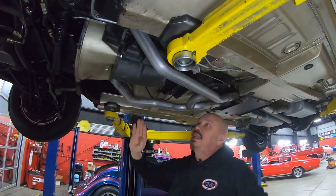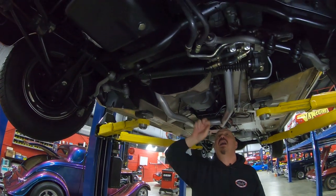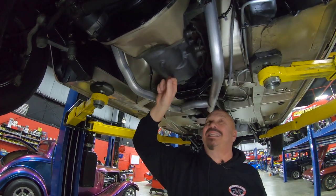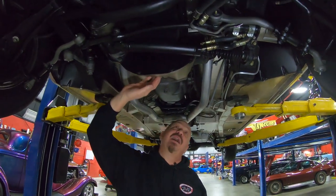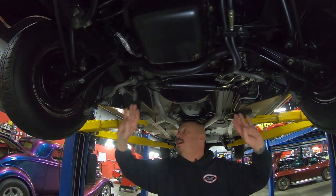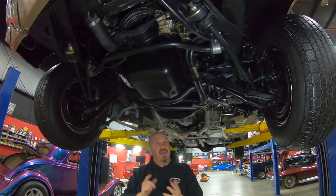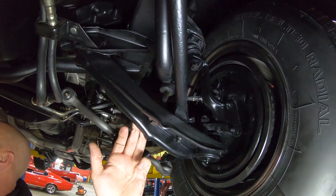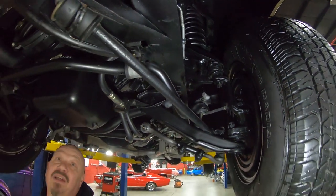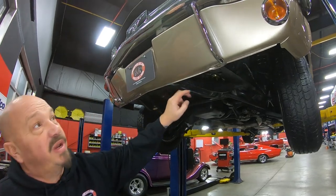The floorboards in the car have been replaced. It's got torque boxes on both sides, which is very cool. It's got a top loader trans - that's a four-speed Ford transmission. The car was born with a four-speed and this is not the original but very similar to what would have been in it from the factory. It's got a Ford stamping on the bell housing and the factory style clutch. The car does have power steering. Brakes front and rear will be pulled apart - wheel cylinders, lines, springs all checked. The lower control arms look like they've been replaced, bushings and sway bar replaced too.